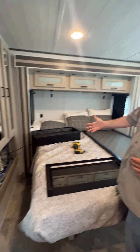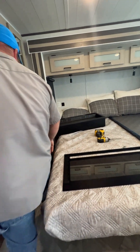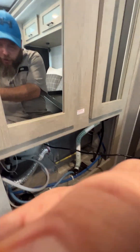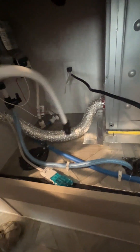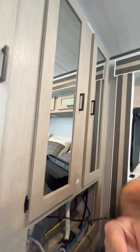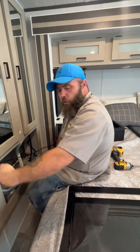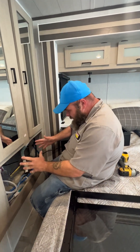Our fireplace is currently out of the wall — this is where they put your entire winterizing system. You'll have a valve here that you turn, and then it goes to this hose that goes into your bucket or jug of antifreeze. I always recommend using a five-gallon bucket if you're using more than a couple gallons. There's also a lower valve to bypass and shut off the ice maker. Right now it is in the on position, but when you go to winterize, you have to make sure that also gets winterized since water has gone through it. Then from there, you just turn on your water pump to winterize your coach.